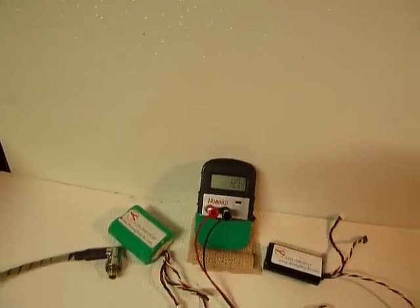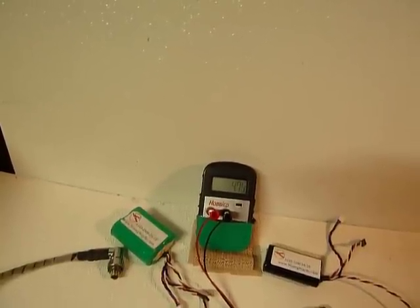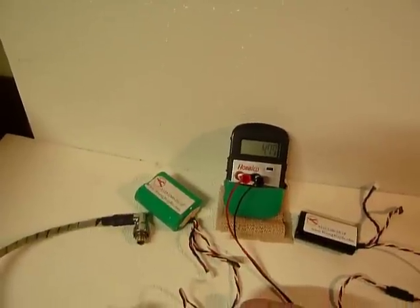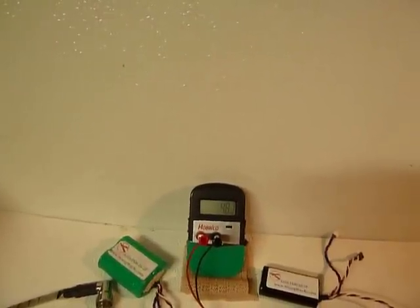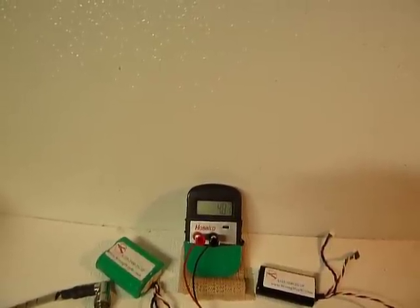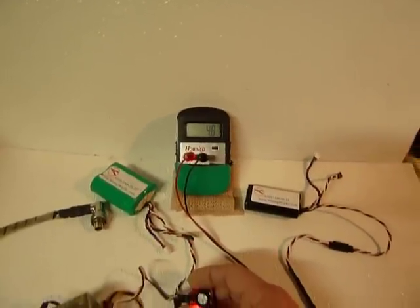Take it off the charts to 15,000 RPM — 4.71 volts. So at your typical 7,000 RPM you're looking at 4.76 volts at the ignition. If you listen, the spark plug sounds just the same as it did on the full battery. The R6L is not at all unhappy running at 4.7 volts — and now at a thousand RPM idle we're seeing 4.8 volts on a battery that started out at 6.5 volts.